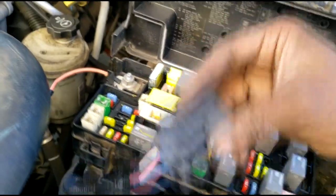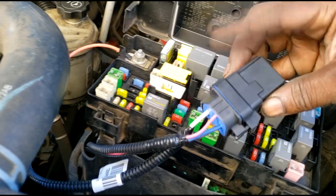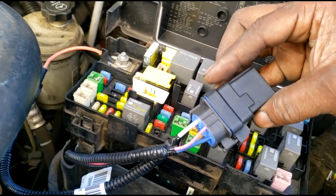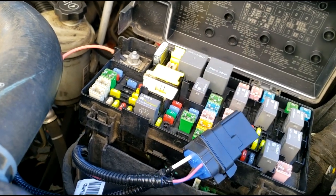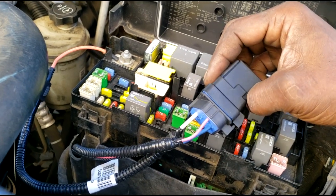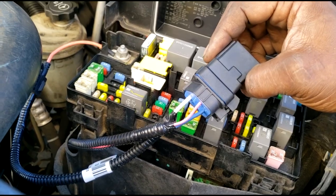Guys, this is very important. Do not just leave this laying around. You don't need this to move, vibrate, or anything. Remember, this is not the updated relay. Over time, I suspect when this relay starts being used a lot and gets hot, the silicone in here may leak onto those contacts and cause the exact same problems. I will inform my customer of such.